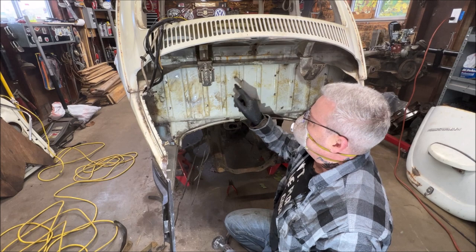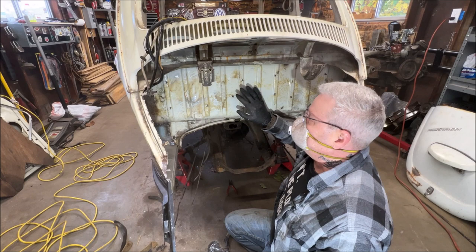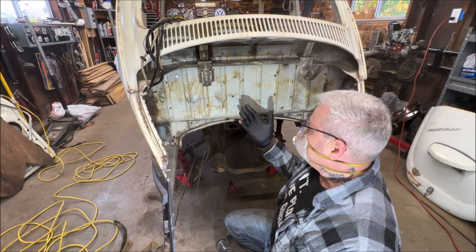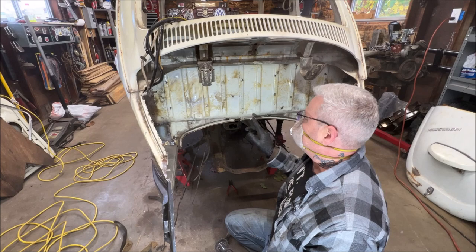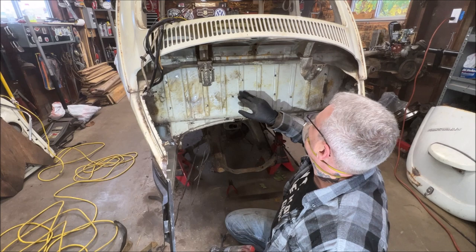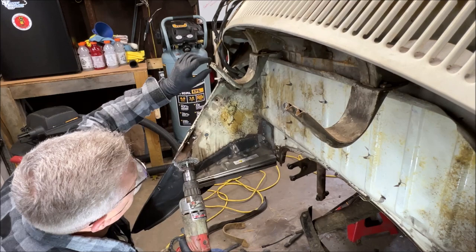Whatever you do, watch with these wire wheels — they are extremely sharp. The wire wheel's cutting it down. I don't have to have this perfectly smooth; I just wanted to get the heavy stuff off, any loose stuff, and then we'll rust bullet over it. The more rust bullet we put in this car underneath and in the back, the better. I'm going to go ahead and bend this tab out and get all up through here. I'll speed the film up moderately — we're going to clean all this up and then we'll start the rust bullet, and we're going to straighten this track.